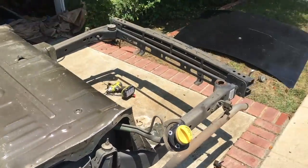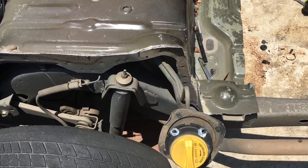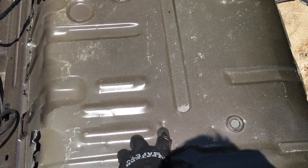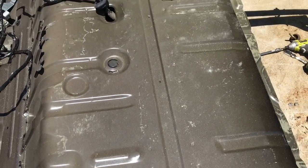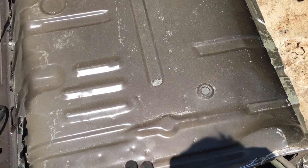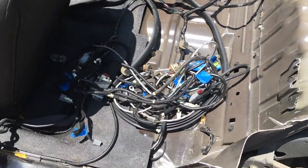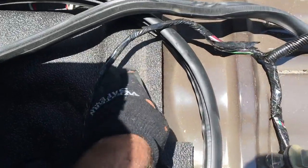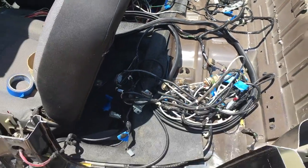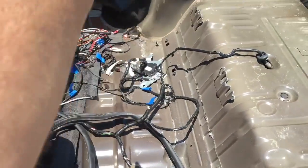Okay, so back is off, and the gas filler comes out. We have to be careful on that cut. So what we're going to do now is a cut straight down there. You can see all those spot welded heads. That's for a mounting cross member that runs over. It's a gas tank mount right there. So we're going to cut just about there, and then I'm going to cut the high ridge here, there. The actual floor itself is going to go shorter than that, but that's where we're going to cut for now. So we're going to be taking this center section out.